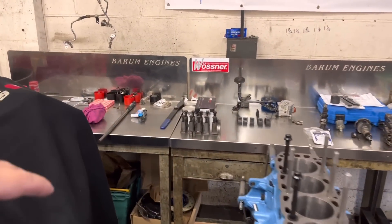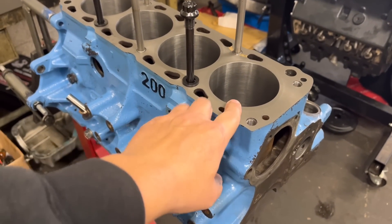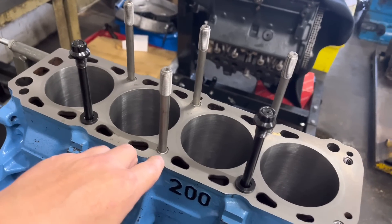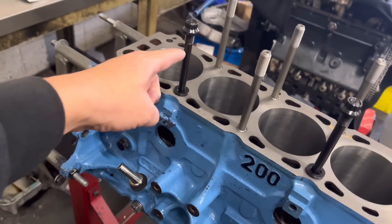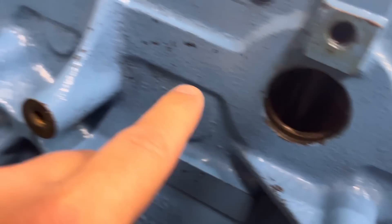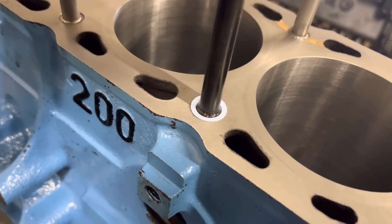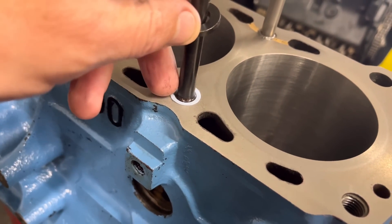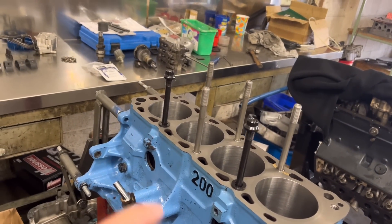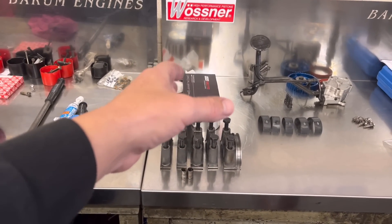This Cosworth — I've got everything laid out, cleaned, and ready to assemble. This is just a short motor, the one I put the ductile iron liners in. All the bores are finished. You can see the four existing studs that were in it — we've cleaned out the threads and they're lovely. These are the two I've just redone, going the five mil deeper in the base of the block so we don't break that lug off. We've put the 17mm groove in the top, five mil deep, for the oil seals. I'm confident this is going to be bulletproof. All we've got to do is size and balance the rods and put the cutouts in the pistons, which I'll do later today.